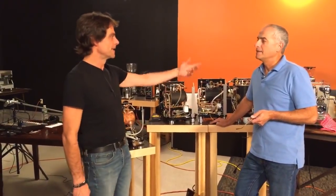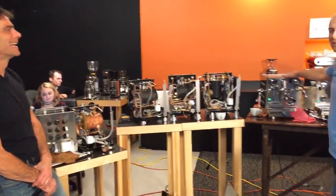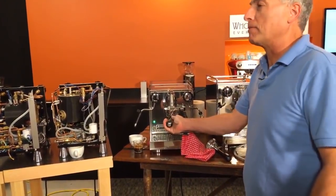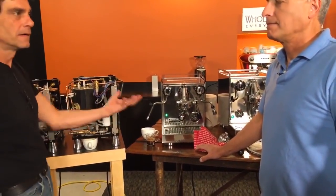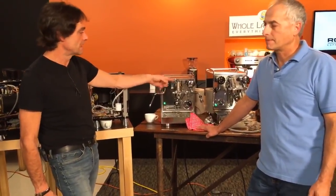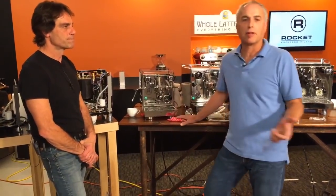Or at least a PID on the heat exchanger to help keep it more stable temperature — which is a little better. The Apartmento does have bigger temperature swings within the boiler, but that gets tempered because it's a heat exchanger and you have the thermosiphon going through the E61 — so the swing's not terrible, just not as consistent, and you can't change temperature. You can do a cooling flush of about four or five ounces of water through it to cool it down a bit before brewing to give you some way to vary it. But if you really want to be accurate, a PID boiler machine is the way to go.